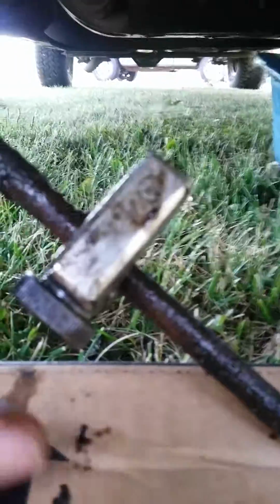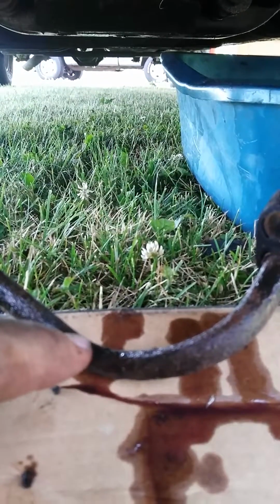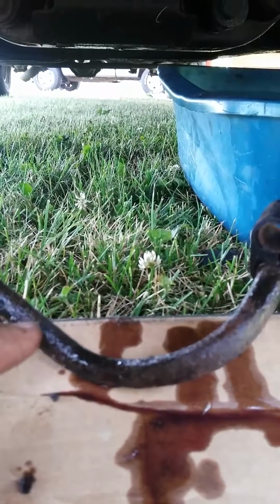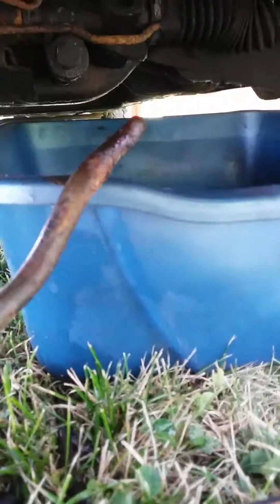And then I just clamped the wire cutter here, because whenever you have a leak, because it's leaking right here, whenever you have a leak, it's because the lines are pretty much rotted. So rather than cutting, you know, right here and then right here, just enough to get rid of that crack, you want to go a little farther down the line where it's clean and not quite as rotted out.